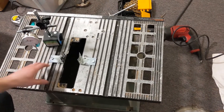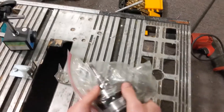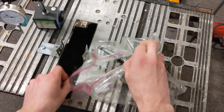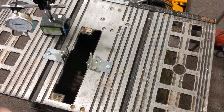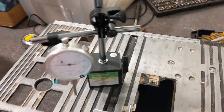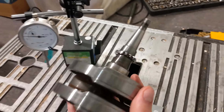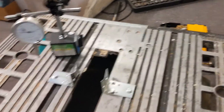Quick video here. We needed a way to tell if a crankshaft was in true or not — we needed to test the runout on it. And we didn't have a set of V-blocks, how you're supposed to do it. So we picked up this dial indicator from Harbor Freight. It's not great, but it measures in thousandths of an inch increments, which the specifications of this crankshaft called for — no more than one thousandth of an inch.